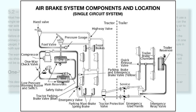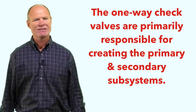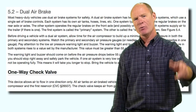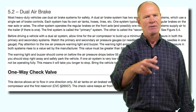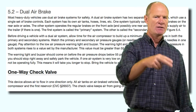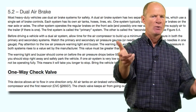Interestingly, the California CDL manual shows a schematic of a single circuit air brake system, but they haven't been single circuit since the 1970s. The system was divided into two separate subsystems — primary and secondary — denoted by the two gauges on the dash. The valves primarily responsible for this division are the one-way check valves at the entrance to the primary and secondary tanks. To check those valves, note air pressure over 100 pounds, go out and start draining tanks. The tank that doesn't drop the dash needles is the wet tank, since there's no gauge on the wet tank.